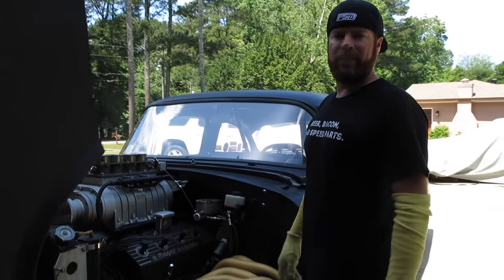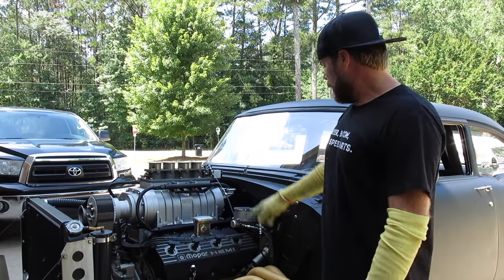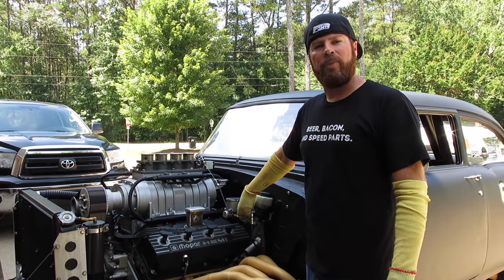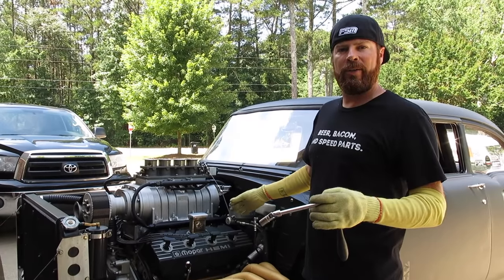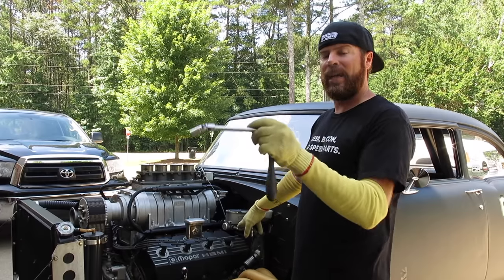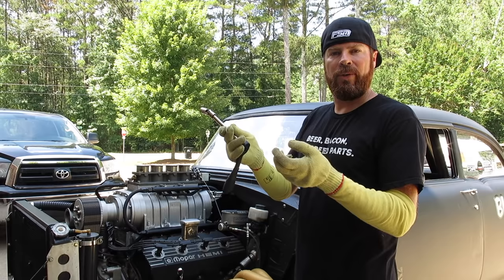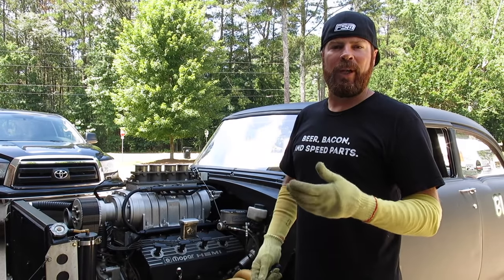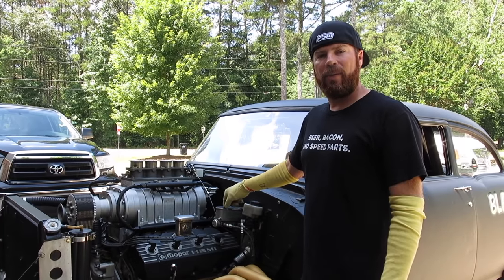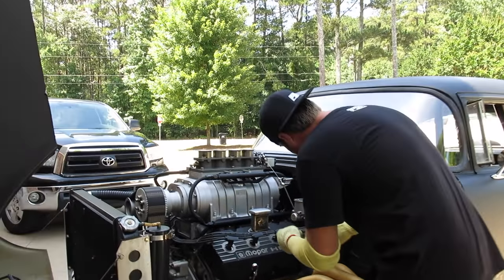And if you've done like I've done and mounted an engine like this Hemi that's way too big for this Chevy, you can get your brake booster off if you mount it with steel braided flexible brake lines. Now I know they swell. This isn't the kind of thing you want to use for road racing, but for a car that drag races and only has to stop at the end of the track, you can put about 16 inches of brake line there that's flexible. And it really isn't going to hurt the car's braking performance that much. But what it is going to allow you to do is get this thing off the firewall quickly so that you can get that valve cover off that engine. Check it out.